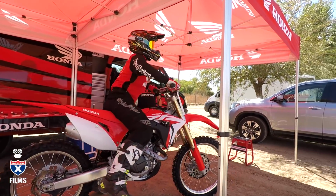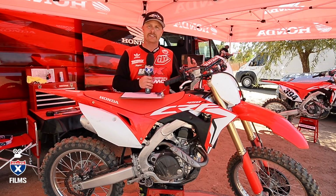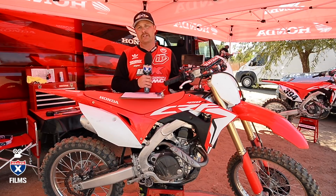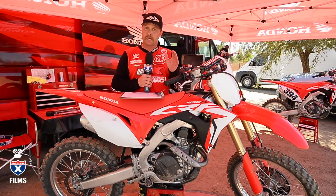In 2017, I loved the way that bike worked. The spring rate for me seemed just right, but I'm a little on the light side for a 450, so there were some guys that thought it felt a little soft at times. So for 2018, they went to a stiffer spring rate, but they adjusted the valving so that even guys like myself would still feel like it was working for them.